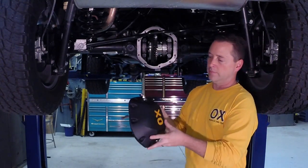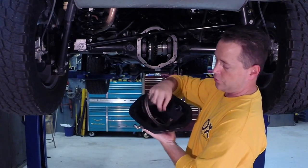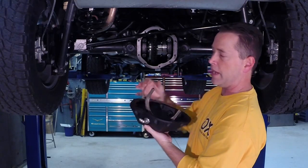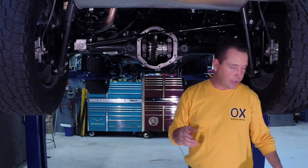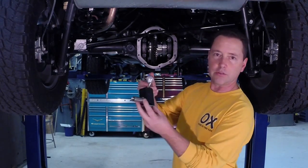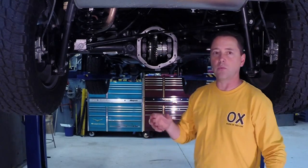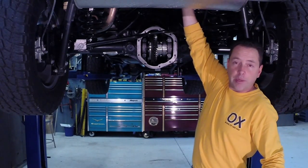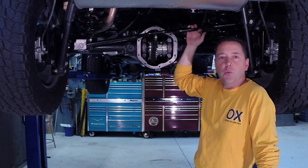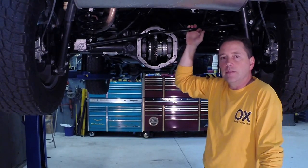This particular air cover — I'll show you how it works. Basically, you just plumb the air into the system right there. This is a pneumatic cylinder, and it drives the fork back and forth. If you're using a manual system or electric, we're going to do the same thing — just drive that fork over mechanically with a cable, done with this little shift lever you can mount up in your vehicle. The electric system operates the same way; we're going to put a cable to it, but we'll have a little electric actuator that mounts up here, then run a harness into your vehicle and a switch, which will also give you an indication of whether you're locked or not. That's the three different systems.